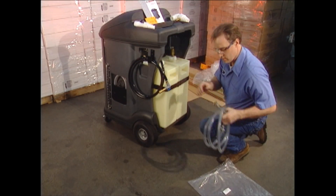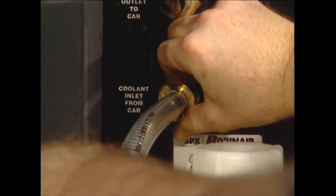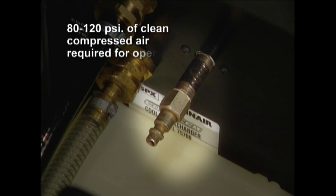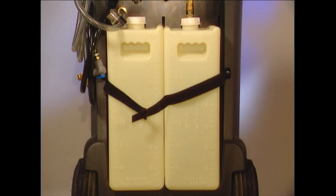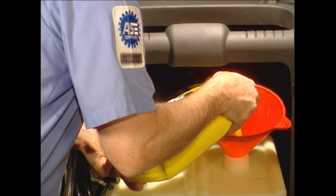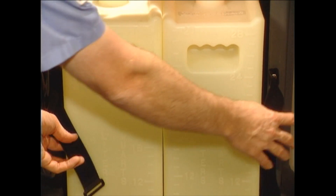Now attach the clear hose to the bottom coupler marked Coolant Inlet from Car. After verifying that valve 1 and valve 2 on the 75700 unit are in the OFF position, connect a user-supplied air coupler fitting to the air supply inlet — this is where you will attach the shop airline. 80 to 120 PSI of clean compressed air is required for operation. The two external coolant supply tanks shipped with the 75700 allow onboard storage of two coolant types. Fill one supply tank with new coolant and install the dip tube cap on the tank. You may fill the second supply tank with a different type of coolant, or leave it empty at this time. The tanks are designed to fit side by side on the back of the unit.